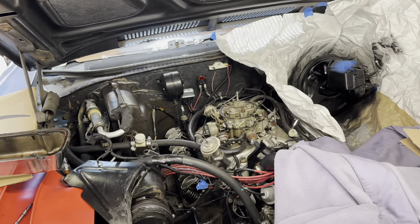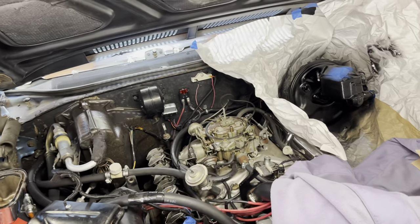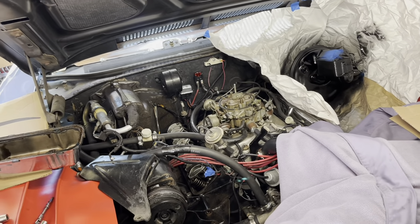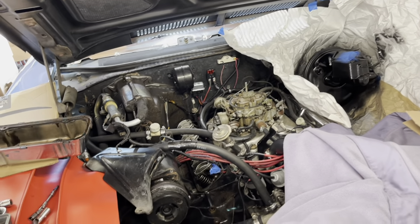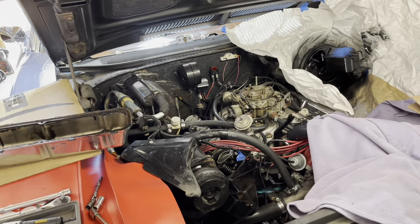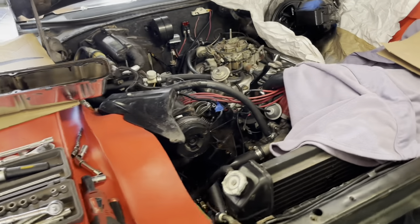That's just how I do it: from the battery to the block, the block to the frame, and the block to the chassis — that way it gives it a good solid ground all the way around. Grounds can be problematic and a lot of times electrical issues do stem from bad grounds, especially on an old car. I do know that this harness was replaced at some point before I had the car — it was American Auto Wire, I believe. I used to have trouble starting the car, but whoever had it fixed it. It starts on a dime, starts great. I'm just having that voltage drop, which annoys me, especially if I want to put a stereo in it. Hopefully with the new ground straps and alternator, that will all be good.